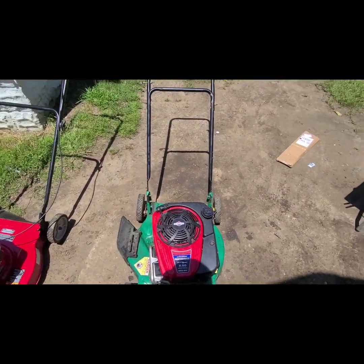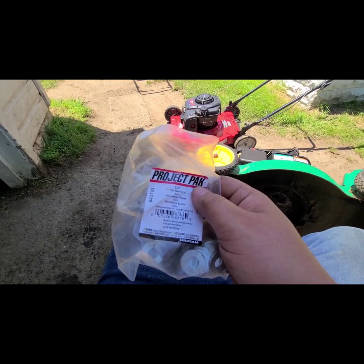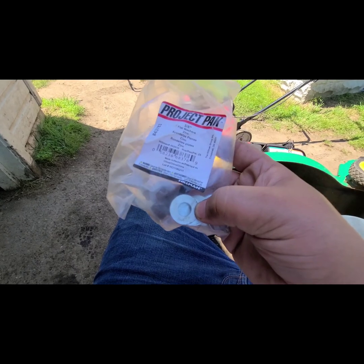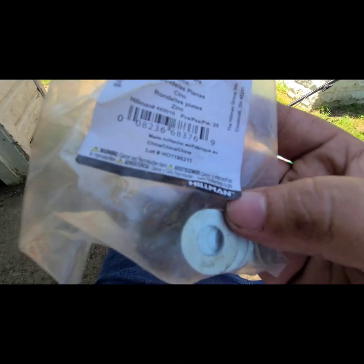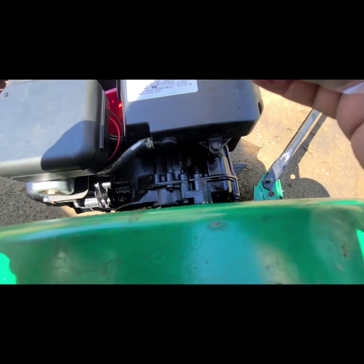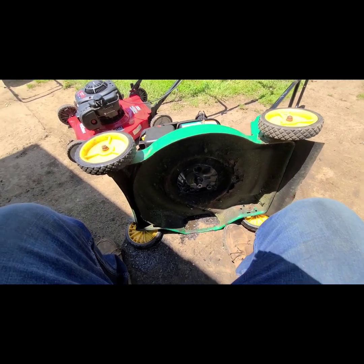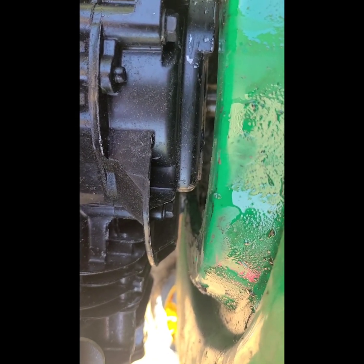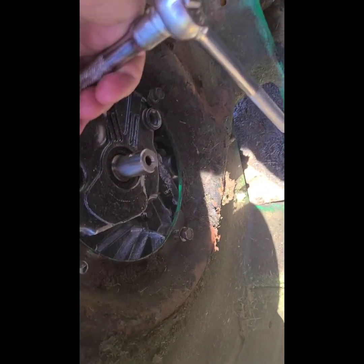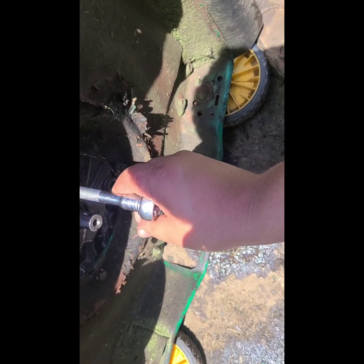We're going to go ahead and mount this motor. One thing to go over before we do: this tip can work on any motor swap project. If your shaft is a little long, these are zinc three-eighths flat washers with a three-eighths inside diameter. These can slip on a push mower motor mount bolt and you can use these to raise your engine up if your shaft is too long. We're not going to need these so we'll set them aside. Now one more thing — there is a part of the block that is molded to fit inside of this hole on the push mower frame. This frame is already made for a three-hole mounting configuration. I'm going to go ahead and start putting these bolts in.